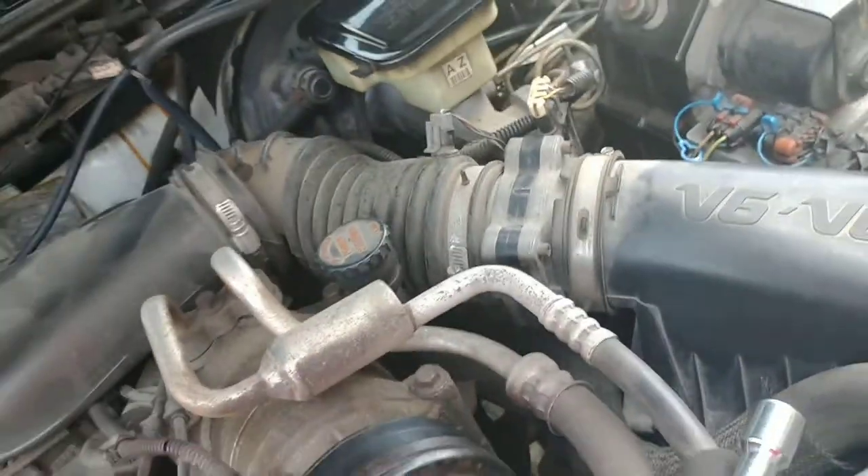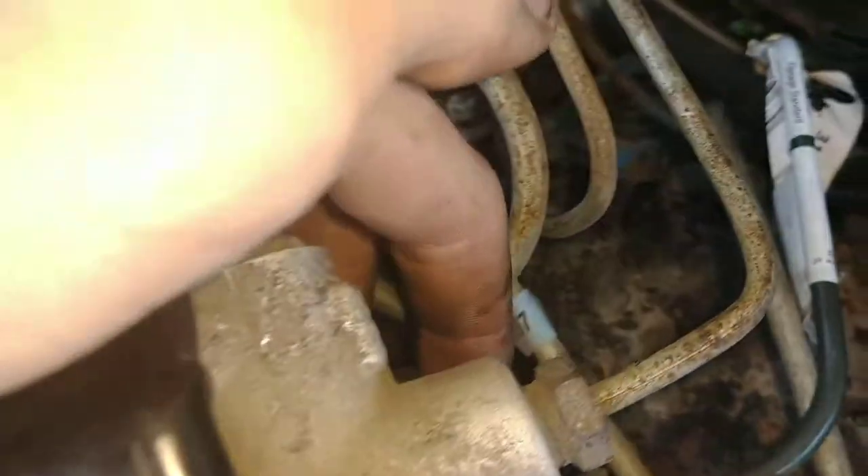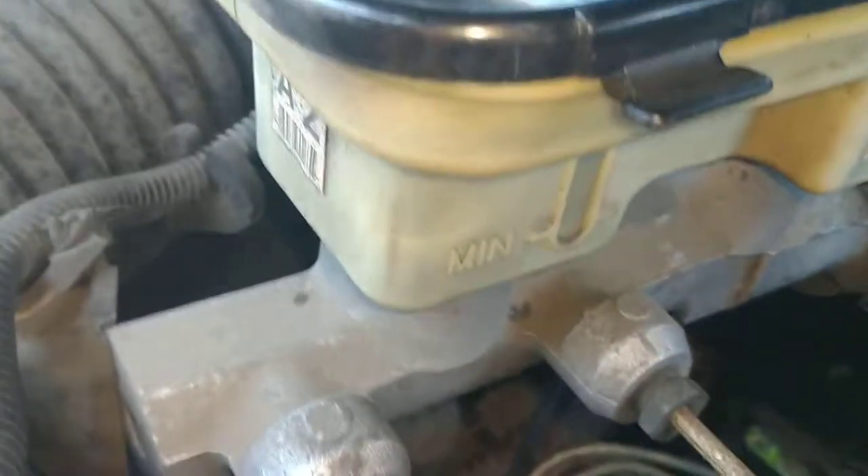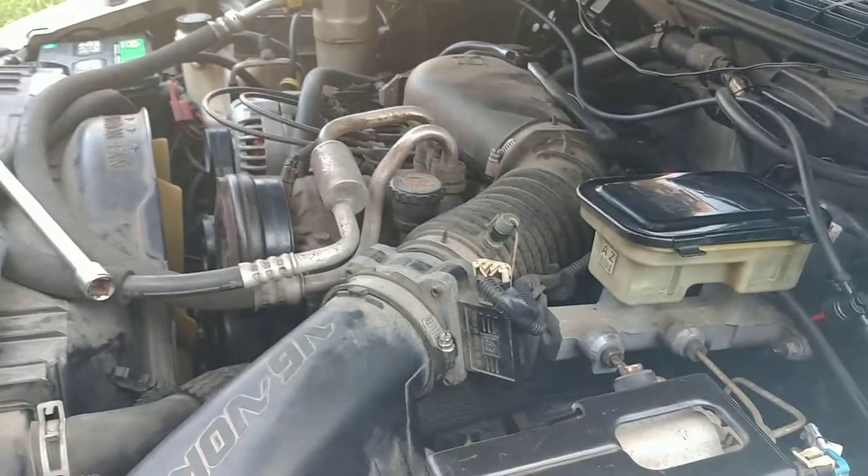An air conditioner is on the way — I'll do a video on that. Right now I'm in the process of replacing this front brake line to this front wheel, under the fender here. I was replacing it and I realized this is a different size than what they sent me. This stupid ABS system uses a larger size bolt that goes in there, so now I have to go back to the store and buy an adapter. The brake lines I bought aren't the right size for this system — go figure. The ABS module doesn't even work anymore, so I don't even know why I'm worried about it, but that's more money I'm not going to spend right now.